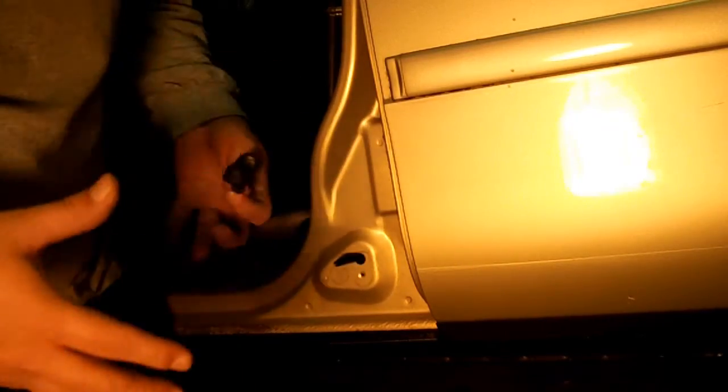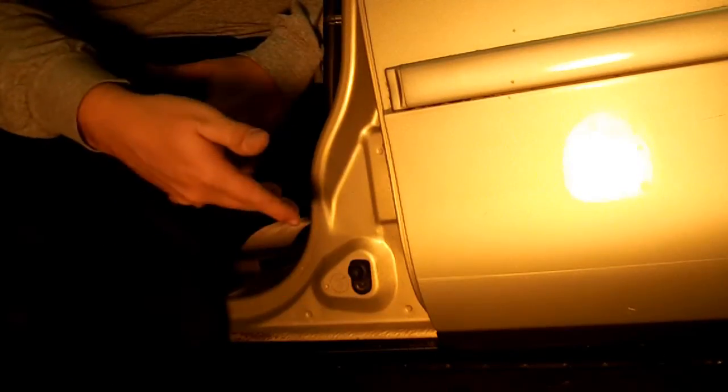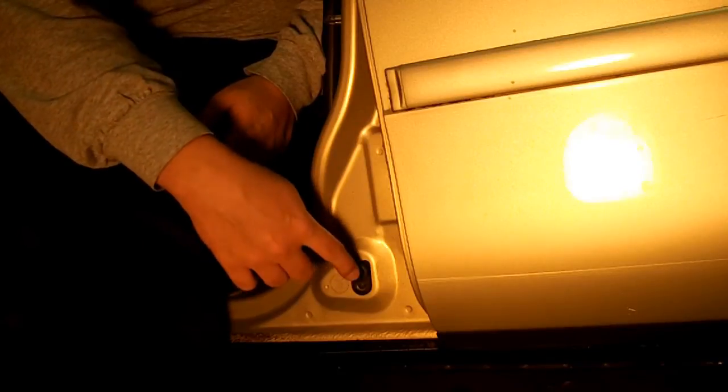That's how you check a good door switch, and this is a good door switch. This is just a hypothetical — my car is not actually having an issue, I'm just demonstrating. All we have to do is reconnect the switch, make sure it's in there nice and snug, plug it back in, and screw it back down. If you get a new switch and have everything connected correctly, when you press this there should be no more beep. The door courtesy light will go out too. Lesson 22 — blessed silence. That is how you repair a broken door switch on a Mazda 626.